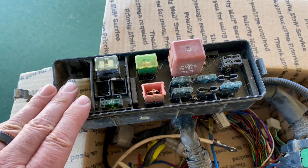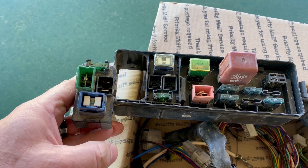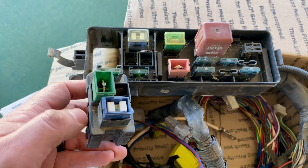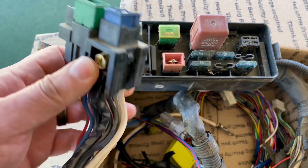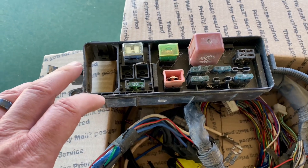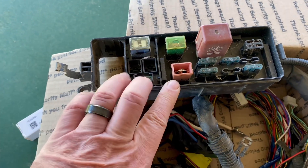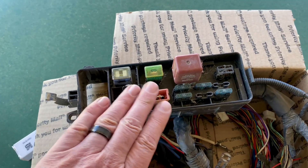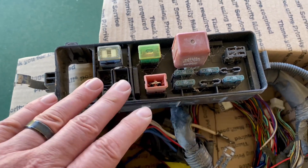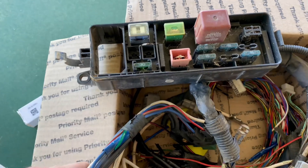All that will basically be fed from this secondary system. This extra circuit is going to use a 180-amp fuse because I have a high-output alternator — a 180-amp Sequoia alternator. We're going to go through a 180-amp fuse, through the lugs for 180-amp fuse capacity, and that's basically just going to fuse between the battery and the alternator. Then we're going to come off that and feed the 100-amp fuse, which will break off and distribute to the rest of the car as it did from the factory. Everything will be fused and not overloaded. No more burned fusible link.